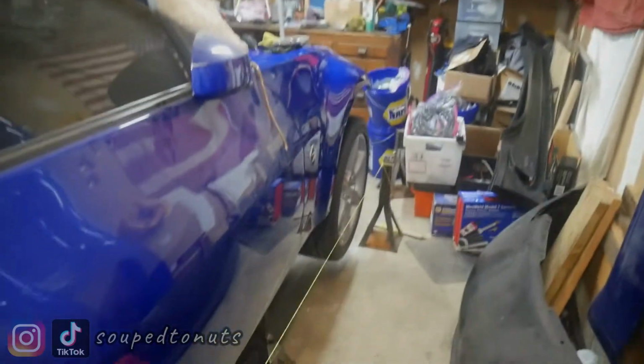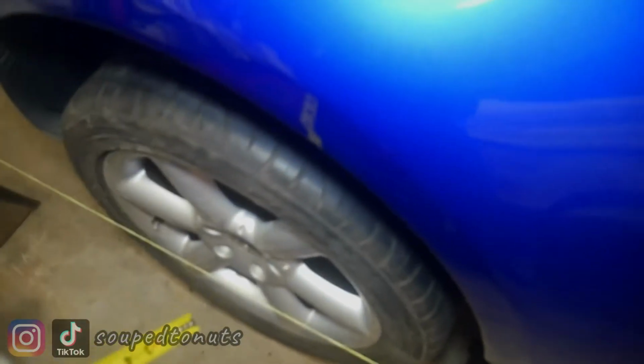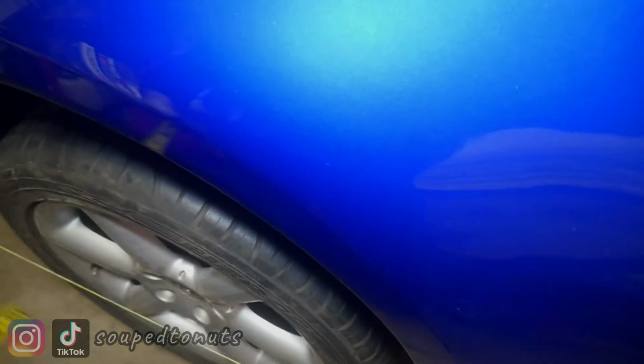So you might have to move that one left or right, and the same thing with the one up there, it might have to move slightly left or right to get this square. You want to square to the back wheel, because the back wheel doesn't have any toe adjustment, it just stays square unless it's damaged or something's bent, which hopefully is not the case.